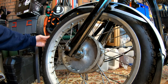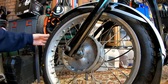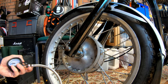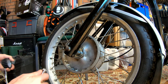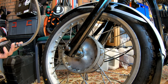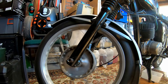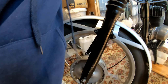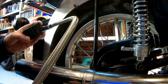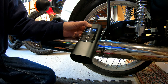Quite low, but then it is inner tubes and a lightweight bike. In a bid to save funds I rather foolishly bought cheap tyres and cheap inner tubes, but they're much better than the 40-year-old tyres that were on it, so they'll be okay for this journey. Front should be 22 psi — you've actually got 24, so a little bit out. That's now 22 at the front. Brakes work — oh yeah, we have brakes. The rear is only on 20 so we need to put a little bit in that, pump that up.